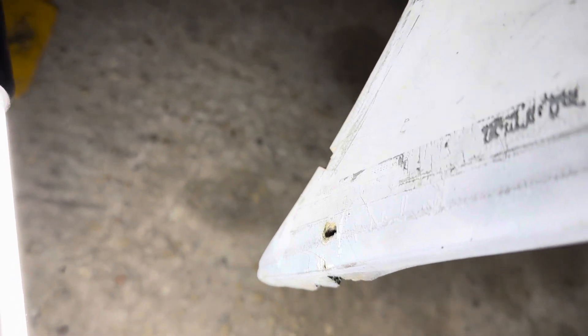Stay tuned for that. We're going to clean this up and get it ready for some body work. I'm not a body man, but I'm going to say it looks good. A little bit of some body filler which is good to go — that was just a little rip. On the side here, we're going to end up making a bracket to go right here. I'm going to fasten it, put some filler on top of those holes. It's going to be a 90, so it's going to be fastened to this wall at a 90, and then we trim it down as needed while we're putting it on the car.